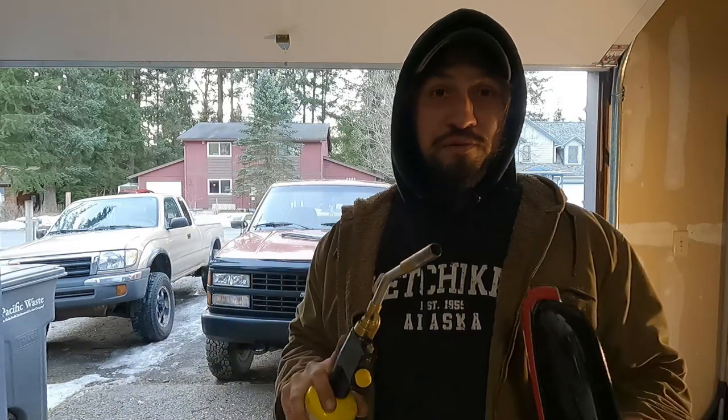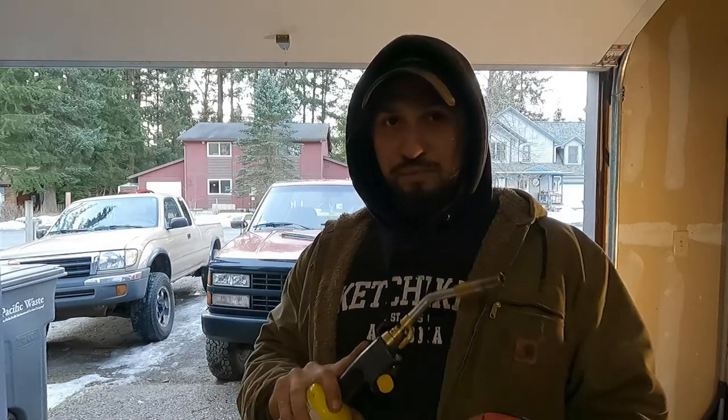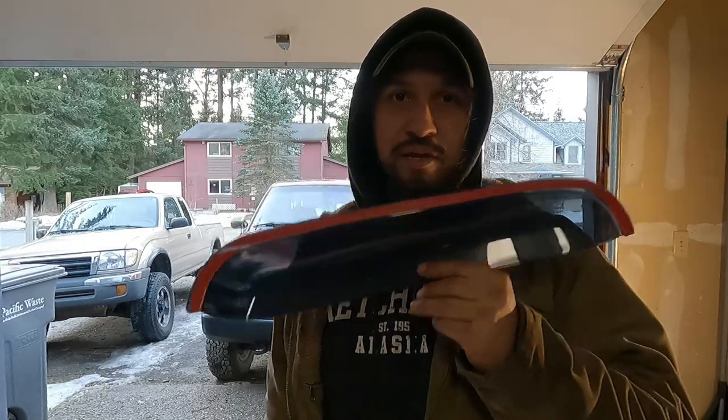This is going to be a twofer. One, it's going to heat the surface, and a warm surface is better for adhesion than a cold surface. Also, there shouldn't be any residue left, but if there's any moisture or anything left over, then this is going to zap that in that final pass. So between acetone, making sure that you have a nice smooth and clean surface, and a little bit of heat, you'll have a winning combination, and you shouldn't have any issues after that.